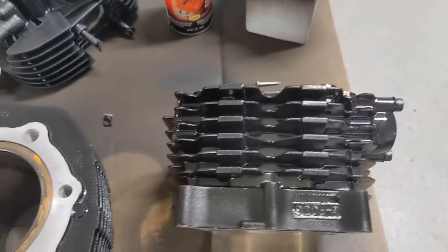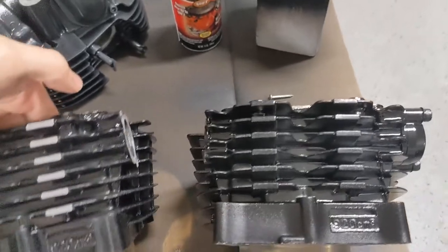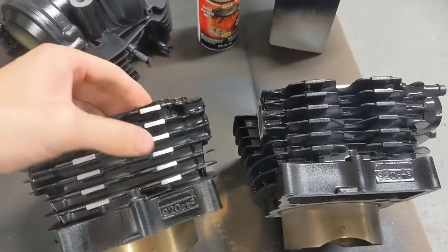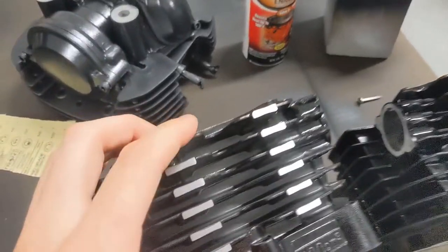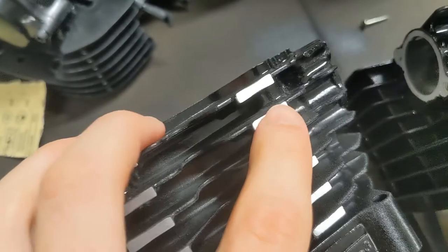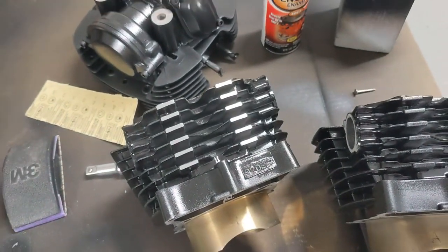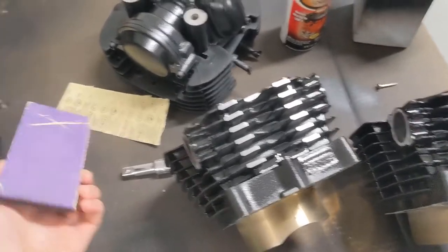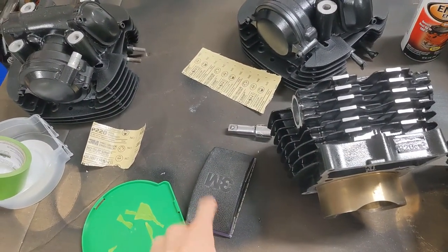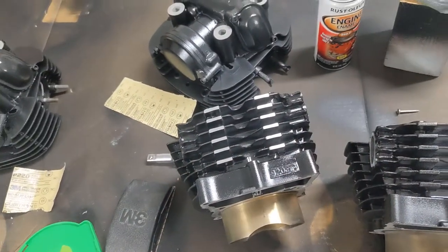The heads are painted, and I was talking to my father — he said, you know what'll look good? If you sand the front of it off — and he was right. I need to get a couple of these top portions cleaned up and get a flat surface. Just hitting it with a sanding block: I did 120, 220, and 320 across that. Looks awesome.